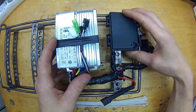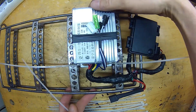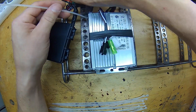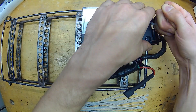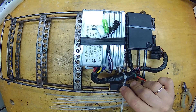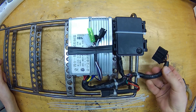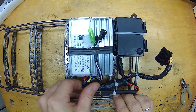Now let's make this power block. I use zip ties for this installation — they are perfect for that. You may have noticed that I removed the potentiometer from my DIY PAS module. I don't adjust it often so I replaced that with a small variable resistor. Now since this is a moving application, we need to be careful when fastening wires with zip ties. Put some protection on the wires if you are not sure about how well they will stand rubbing against zip ties or metal.